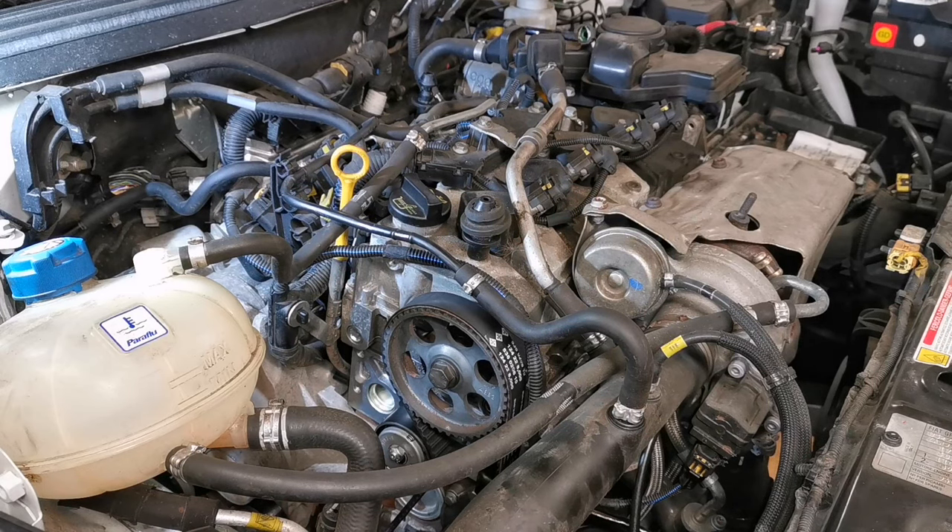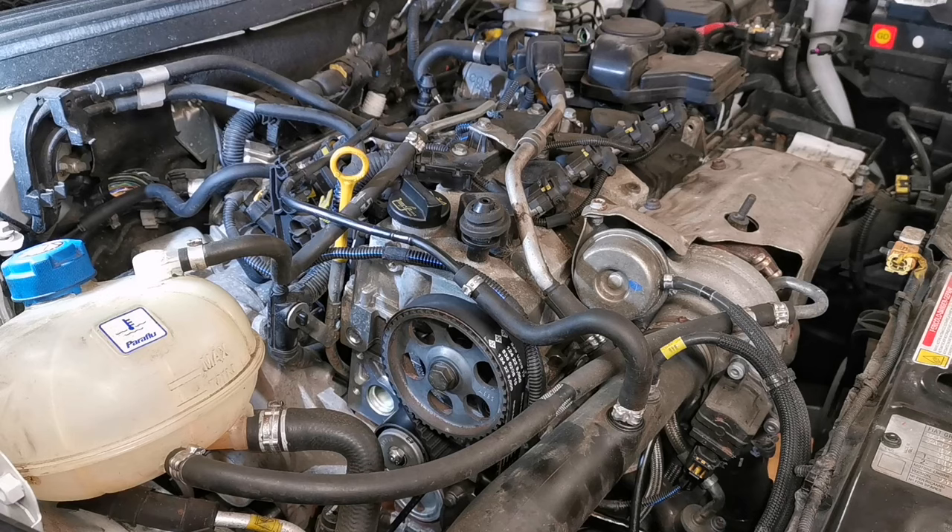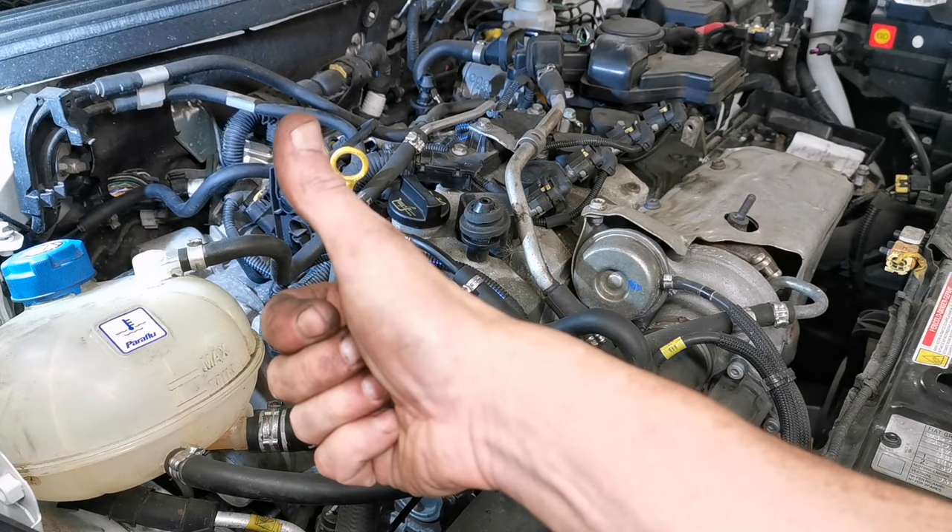That's about all I'm going to film on this one. Just build her back up again — covers on, engine mount on, vacuum pump on, whatever bracketry, wiring and all that carry-on. This video has just been really about the proper way to tension these type of belts with an unkeyed cam and to get it perfectly in time. If you don't do that, it's not going to be perfectly in time and you're going to really struggle putting the belt on. There's a wee bit more work to do on this car — I have to take the front off and it needs a radiator. We'll get her started up before going ahead with that. Many thanks for watching. All the best and bye-bye.